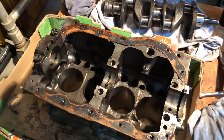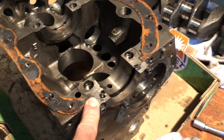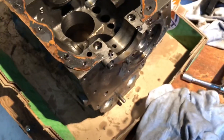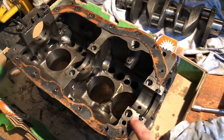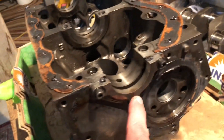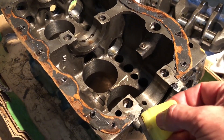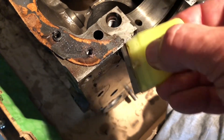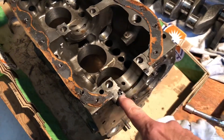We're also going to do the four bolt and steel caps on here. This is just a quick chance to show - I harp on this a lot - the standard rear mains. There is such a lack of knowledge on setting these up. This was the original race engine out of our friend Carlos's Bug-Eye Sprite, and you can see a horrible step. If people remove these and then haphazardly reinstall them, you end up with - you can use a razor blade here - you can see what a step there is. A fingernail even - an incredible step. This will leak like a sieve, guaranteed.